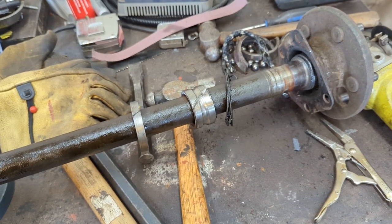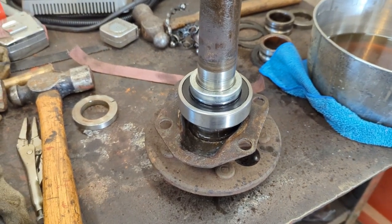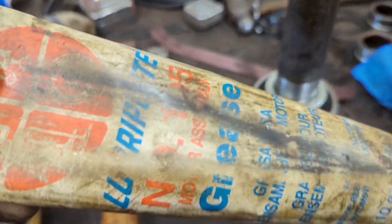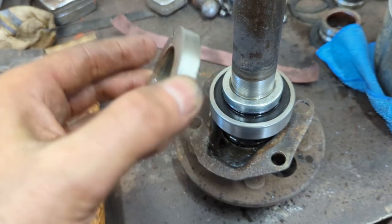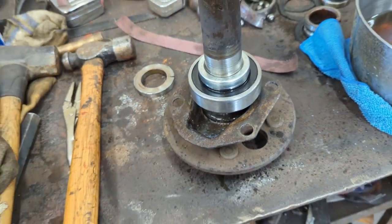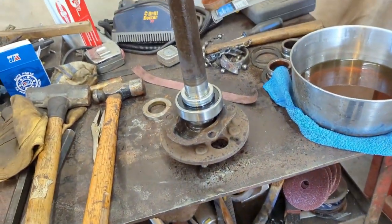Let's get this cleaned up, get the new bearings on it, and put it back in. You don't need to bring that oil up super hot - if it's starting to smoke, you should back off. You don't want to melt the grease out of it; there should be high temperature grease in there anyway. Same procedure, only thing I did different this time: I put a little assembly grease on the shaft before I put the bearing on. Then I used the old collar on the bearing the same way. It worked really well. Same for the new retainer collar. She's ready to go back in the car. Don't forget this piece - as soon as you clean this piece, put it on the shaft, otherwise you're buying a new bearing.